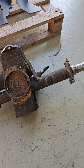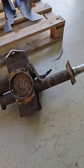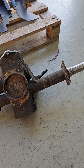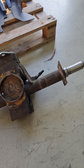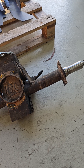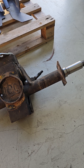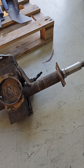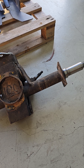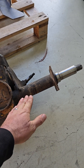There is a misunderstanding that you can change the track — that you can order your van and decide what the track should be. The track really can't be changed in T-Van because the guard, the inner suspension components, the chassis — none of that stuff changes. What Track is referring to is wheel offset, and they're allowing you to match your wheel from the car to the van, and of course they do this by changing this physical offset here.